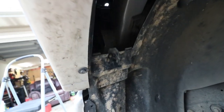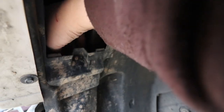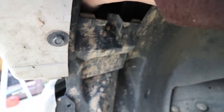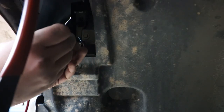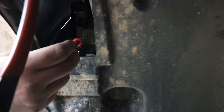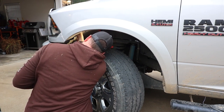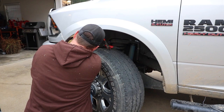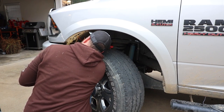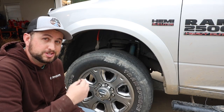You just pull that back and you can reach in there and grab that blinker light. You spin it and it pulls right out. After testing it, we can see the middle one is showing 12 volts, so my run lights is the middle one. There's another white wire to the right — that will be my blinker. There's a black wire, and that will be the ground. Black is commonly ground, but don't always depend on that because sometimes they use other colors.